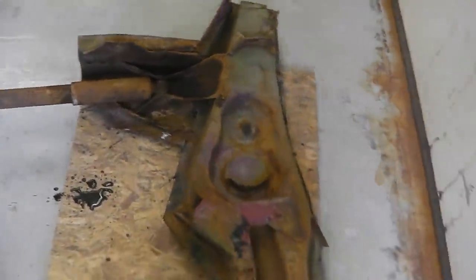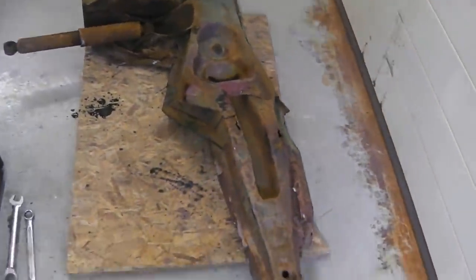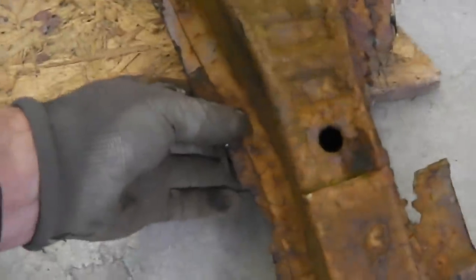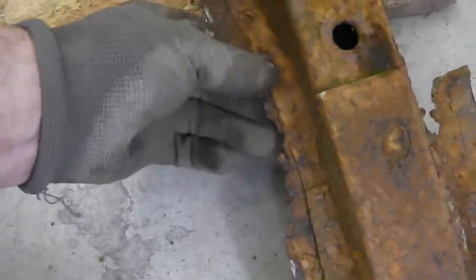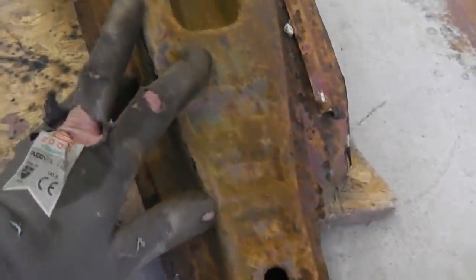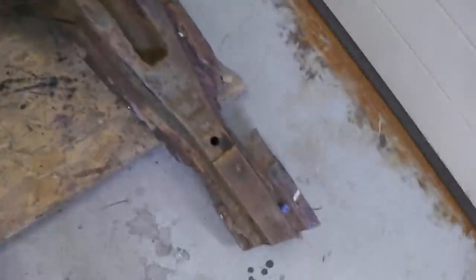There's a shock absorber to remove before we go to dippers, two 17mm spanners to get that shock bolt out, and that'll strip down, and then when it's back and all clean, we just do our usual spot weld removal, and then we can slot that in. I've not welded this area on the car when we put the floor pan in, remember, so it's going to slot in, then we can tech screw that up and get some welds in, and then we'll have that section done. I've not cut out the final chassis leg runs that go under the boot floor because they look all right on this. So we can slot in at that end.